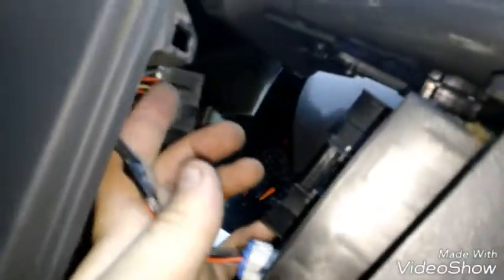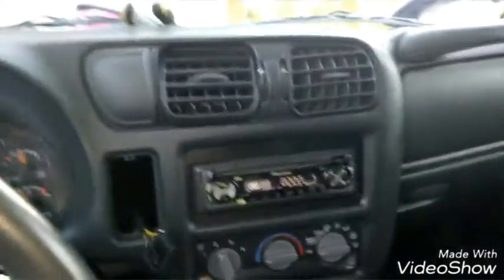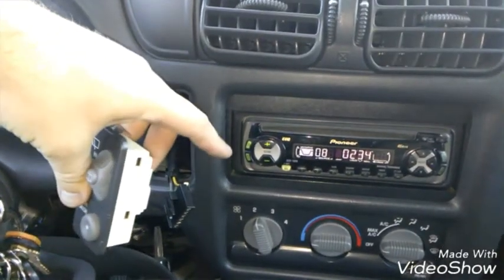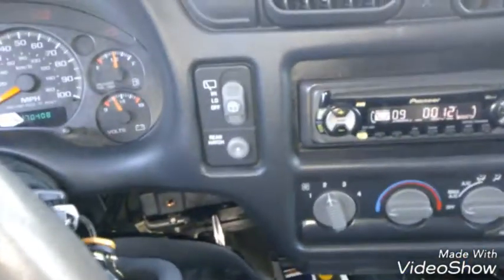Now you got to connect the connectors. Don't forget the connectors. There's two of them on the left, the big one and the smaller one on the bottom. And let's see, there's one over here. Move the shifter if you need to. This one I'm just going to plug in. Also just going to put the dash in fully too. See, I got it all the way in. I just went around and snugged it in. Now I'm going to plug this one in, the switch. Got it plugged in. And then the bottom goes in first and just clip it in on the top like that. If your switches look different, don't worry about it. You know, you might have different features on yours.